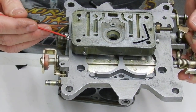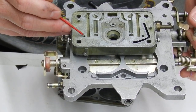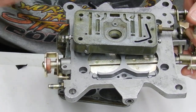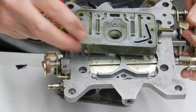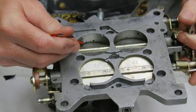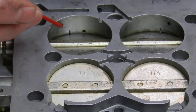With the screw it's coming across here and drawing most of the fuel through the actual idle port instead of the transfer slot. The transfer slot is part of the idle circuit — it's going to draw fuel through there, but when it's got too much exposed it draws all the fuel and you just can't control the fuel through the idle slot.